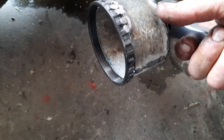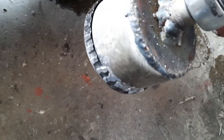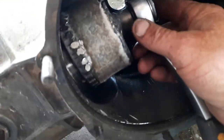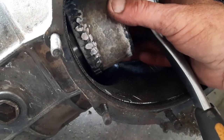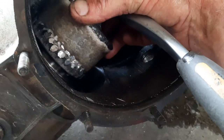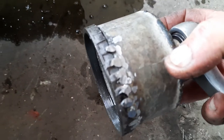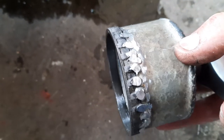This is what I had to do - I made up a bit of pipe. I couldn't get the exact right size so I had to cut it, put a clamp around it to pull it in, and welded an old worn-out socket onto the top of it. I set that in place and welded onto the tops of the teeth as much as I could, wherever I could see each one - and that's how I actually managed to get it out. Now I'm going to have to cut that off and clean all the teeth up.